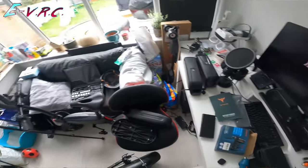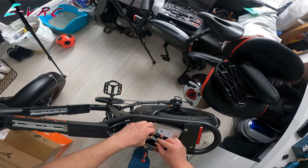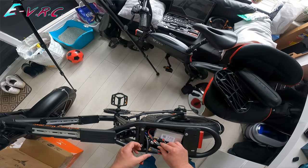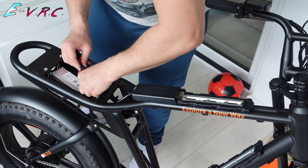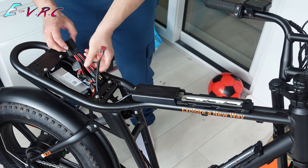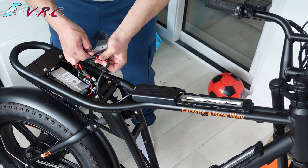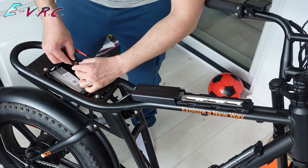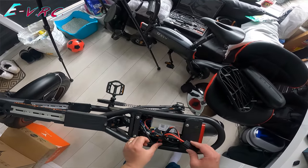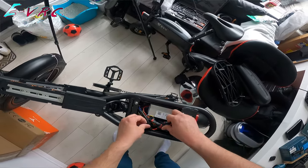We need this — the two battery equaliser — that's going to get connected to that. I'm trying not to touch the metal because there might be a bit of power in a capacitor or something. I don't think it matters which one goes which. Right, now I've got to find the space for this. Luckily there seems to be a decent amount of space so I'm going to twirl that like that and shove that in there.